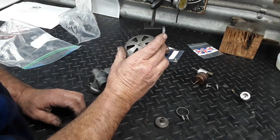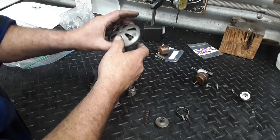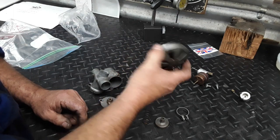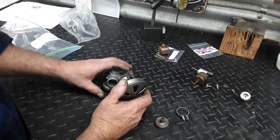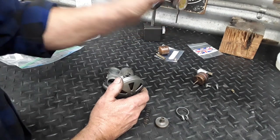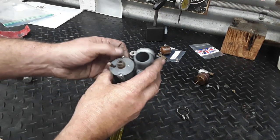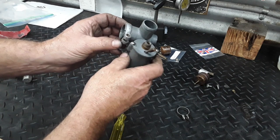I'll drop the air filter - or strangler - in the ultrasonic bath as it seems clogged up with dirt. I've blown through it with the air gun and it hasn't got good flow, so I'll drop it in the ultrasonic bath for a good clean. I'll put all the carby parts in there as well and work through the repairs. I have brand new slides for these 523 carburettors on the way. The salvage job has come out well - even though they're bigger screws than original, it looks the part and no one would ever know.